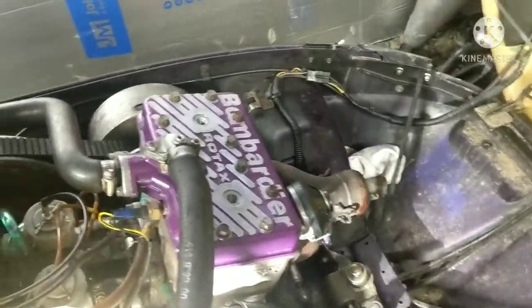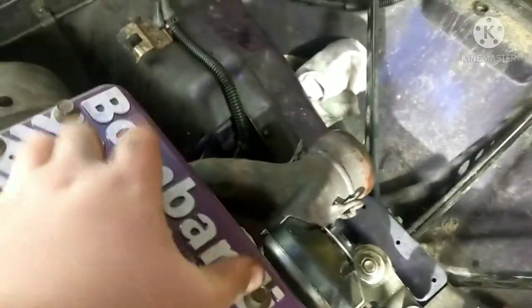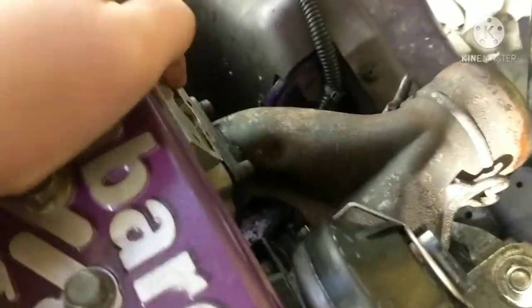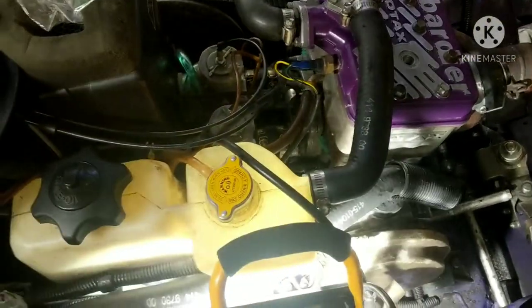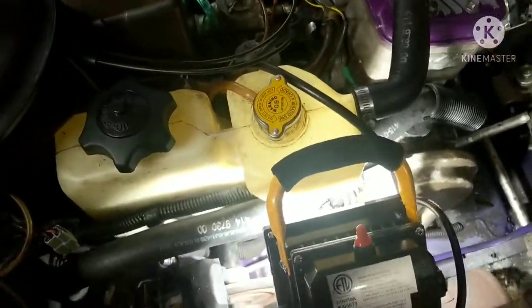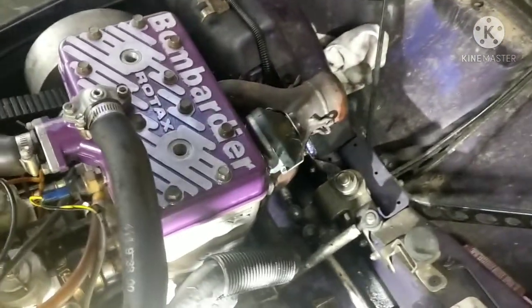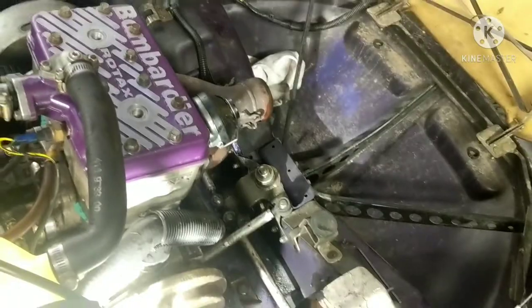So you see, you got the cylinder head all torqued up, 21 foot-pounds, and if you're doing this, you want to make sure you get the 2 shorter bolts right here above the power valves, or the RAVE valves. Now I'm going to get the RAVE valve on this side because it's a different jug. And then we throw the exhaust on, throw some spark plugs on, try to fire it, and then throw some coolant in it because, obviously, you don't want to run it without coolant. So we put that RAVE valve in there and get it in. So, gonna put it in.